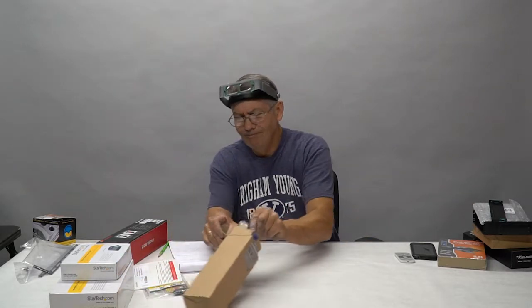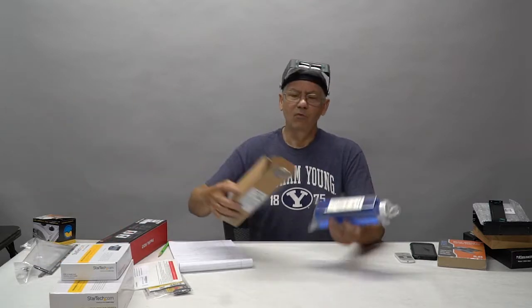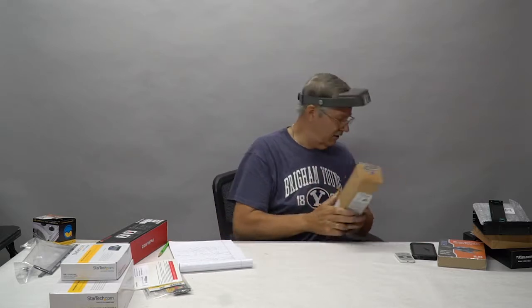One of them is a choice of coolant that I'm using. Okay, this is from Coolants. I like this stuff because it has the highest rating for shelf life. In other words, this coolant could survive in your case for a couple to 3 years without needing to be changed. Most of them require changing in about a year. I chose a UV reactive blue simply because I thought it would be clean in the case. I'll do all of my testing with distilled water with a biocide, and then this is for the final fill. I've got 3 liters of this that'll go into the system.